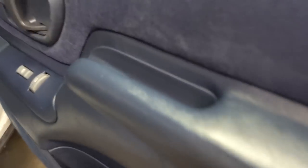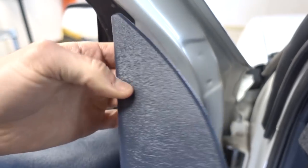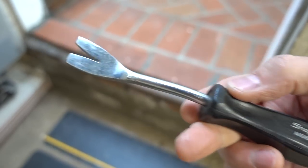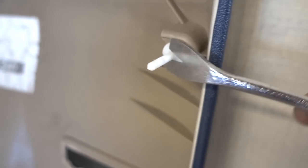The first thing you're going to have to do with these trucks is get that door panel off. On the armrest there are two Phillips screws — grab your screw gun and zip those out. There's also a little triangle piece of trim that covers the access port for the side mirror; that has one clip in it. You can probably stick your fingers in there and pull it straight out. After pulling that piece off, I absolutely recommend a trim panel tool. Slide it behind the panel where the pins are and pop those pins out — if you just try to yank on it by hand, you'll probably break the clip points on the door panel or deform the panel itself. Go to Harbor Freight; they sell a whole kit for under $10.